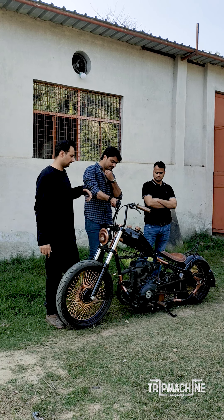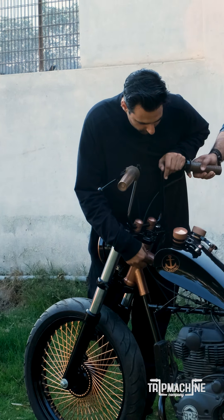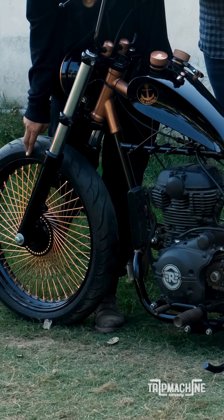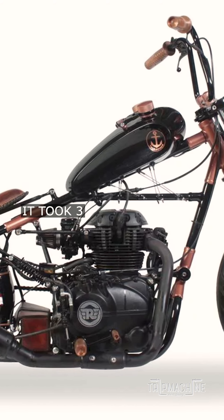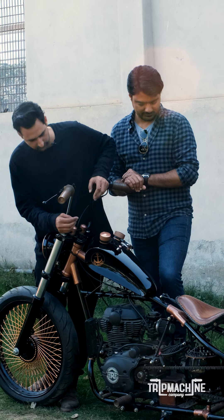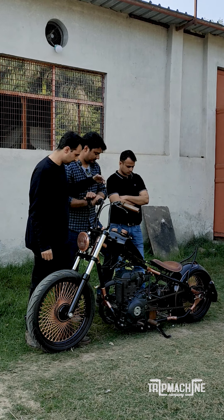The point where I was adamant about chassis design was the spine — I wanted it to be straight all the way till the axle plates. That was a feat to achieve while maintaining ground clearance, these tires, and this kind of rake angle. We did three or four iterations just to bring this pipe as straight as possible without making a longer wheelbase, which was really difficult to achieve, but it was engineered well.